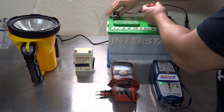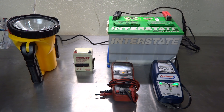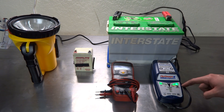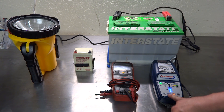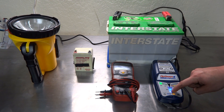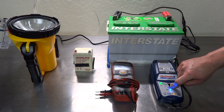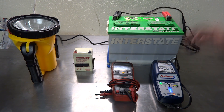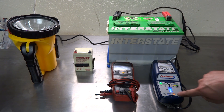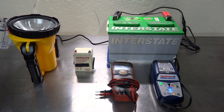When I clip them on the right way, it's telling me this battery is 100% charged with a green light. It's testing it right now — it skipped the desulfate process. When the save light lights up it's desulfating. The first indicator is 1 amp, anywhere in between is 1 to 4 amps, and when the third light in the middle lights up that's 5 amps being pushed to the battery. When it's done it'll do a 12 or 24 hour test to make sure the battery is good, then it turns itself off.